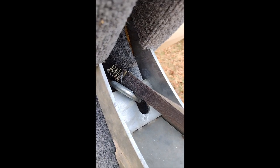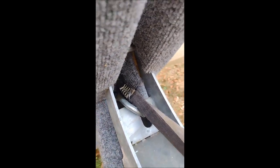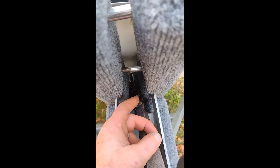I thought I was going to have to special order if I wanted sevens, so what I had to do is actually notch some of this board out. I traced around this metal and drilled my center hole so I had something to line it up on, then notched it out. I took a bunch of little drill bits and drilled the outline of it, then used a wood chisel to chisel out about three-quarters of an inch of the board - that allowed me to make my six-inch bolts long enough.